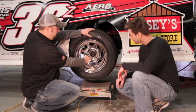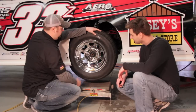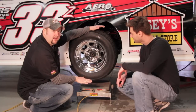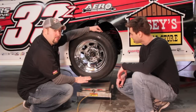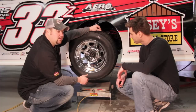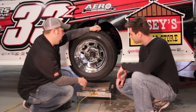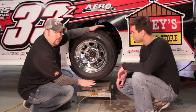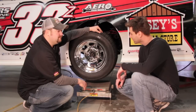It's really simple — you just pull three bolts out. If your axle or axle tube isn't bent, they should come out really easy just by pulling on it with your hand. Then you're ready to set it down on the scales and go through all the other steps before you scale: set tire pressures, unhook shocks if necessary, make sure you've got the scrub out of the front tires, and have the proper amount of fuel in the car.